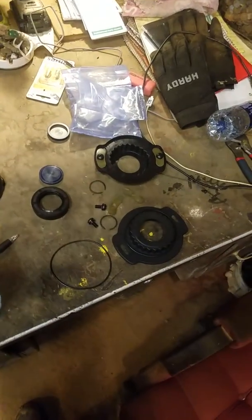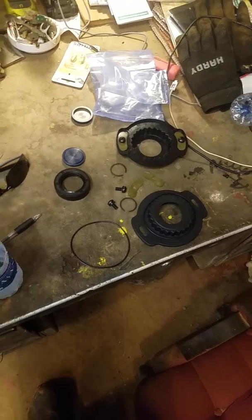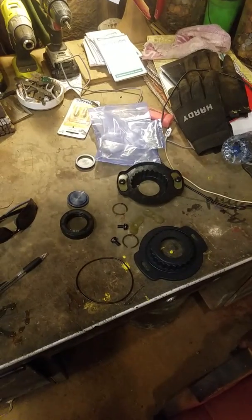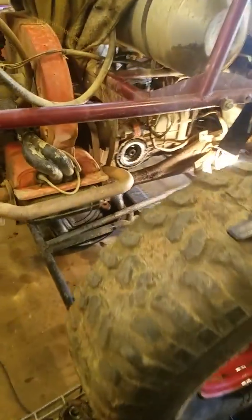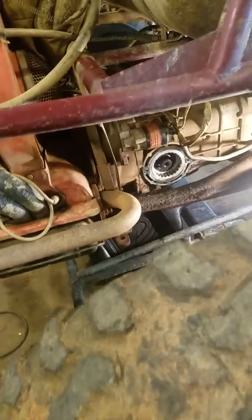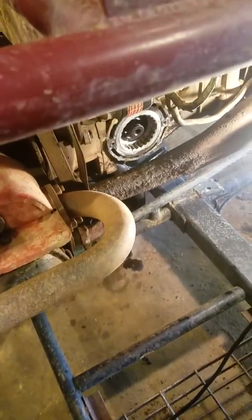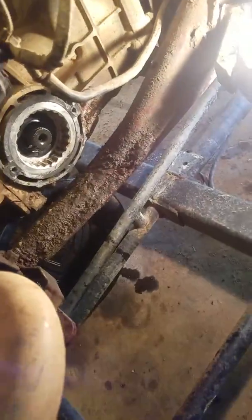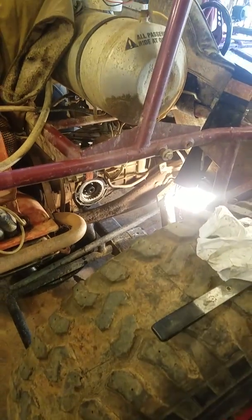Like I said, if you've been searching YouTube for a while and can't find anything on it, here you go. I like to watch videos to see how things work before I start pulling them apart, so this ought to give you a good idea of what you're dealing with. This is on a buggy, but it's the same transmission as a '68 to '74 bus — the 002, three-rib. Up on the top of your transmission there are three ribs. There's a three-rib, five-rib, six-rib, side loader, and a couple others, but if you've got a three-rib, this is what you've got to look forward to. Thanks for watching.